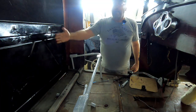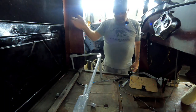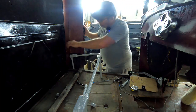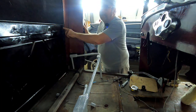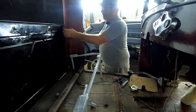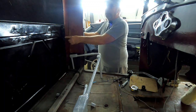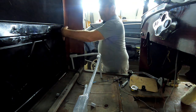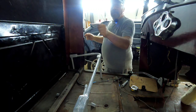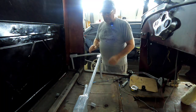To get back here far enough where your back is against the back, the back cushion can only be a couple inches thick - so that's what we're going to do. We can adjust it and tilt the bottom out a little bit if needed, but it will just be attached here. It's not going to flip forward - it'll attach to the back. There are bolts right here that attach this pan to the sides of the body. I can make a bracket that slides under the pins on one side, then a little bracket with a screw from the side.